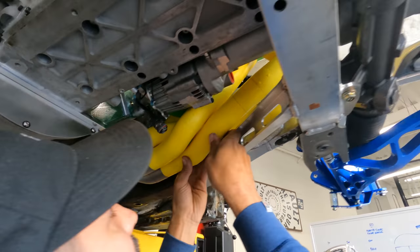Today we are gonna finish the rear sway bar. So the YSFAB kit comes with lower control arms that have the divorced spring setup, and we want the coilover setup. So we got on the phone with YSFAB and got these new lower control arms that just came in. Now we can make our tabs and mounts to finish up the sway bar that will come off of this spring, and we're gonna run the true coilover setup, which is more motorsport style, and get rid of these lower control arms. So if you are buying a YSFAB kit for the A90 Supra and you want this style, and you plan on transitioning over to the coilover setup, just make sure you let them know and they'll get you taken care of.